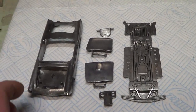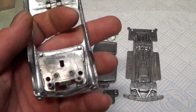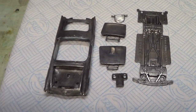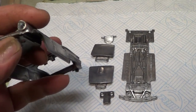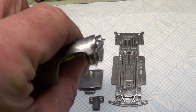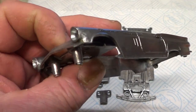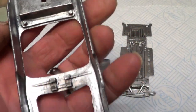Right, here we are then, all cleaned up, wire brushed and ready to prime. Apart from methylated spirits, I haven't rubbed it over with meth yet, so I'm going to do that, and then I'm going to spray the primer on it. I've done a little bit of filing around the headlights because they've been quite misshapen through it being dropped. I've done it the best I can. I filed a fair bit off actually, so I hope it's going to be alright.